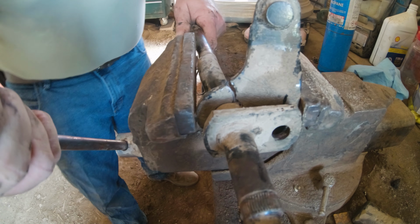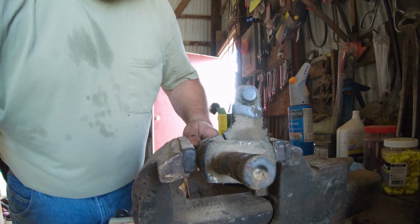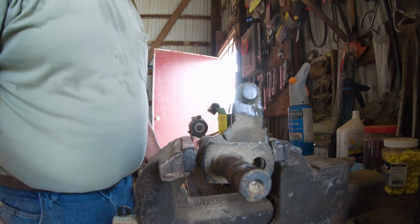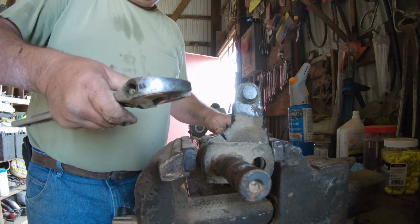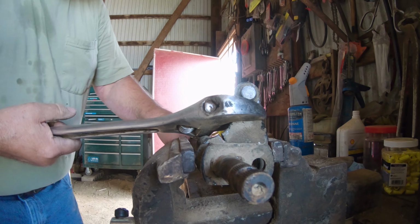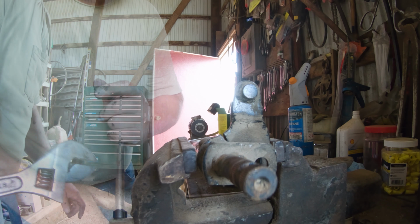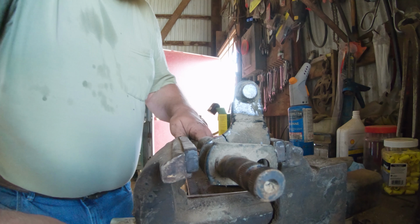So part of the problem there was that that plate was shearing apart, and that was resulting in that plate hitting that yellow depth indicator that was above it. So what we're doing is we're gonna push it back together with the vise, weld it together, and then put it in to see whether it fixed it. And since then, I haven't had any issues with the mower. It lifts just fine. This was probably one of the bigger problems.